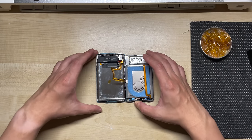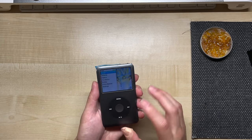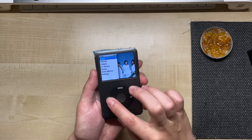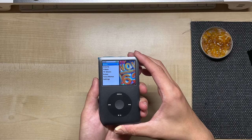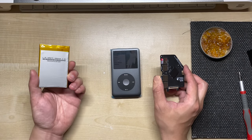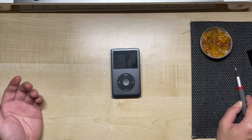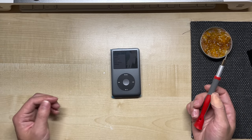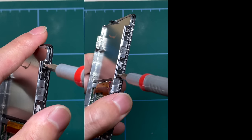Now that the Taptic Engine is fully wired in, I've just connected it back to the front half, and we can give it a quick test. Can you hear that? That is the sound of the Taptic Engine working inside the iPod 7th generation. Excellent. At this point I could just put everything back together with the new storage and battery, but the click wheel and the display do have issues, so I want to replace those — and if I'm going to go that deep into a teardown, I may as well just replace everything including the front case.